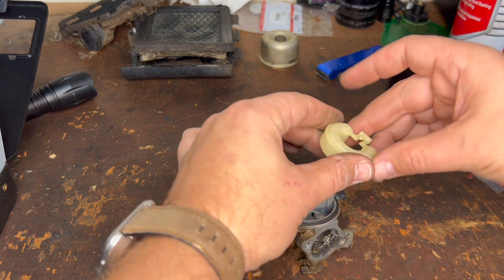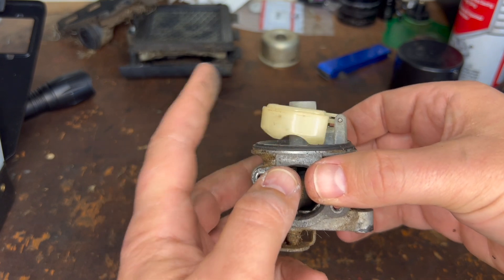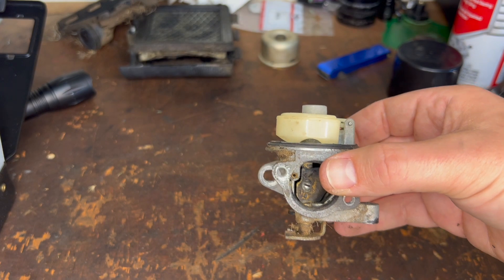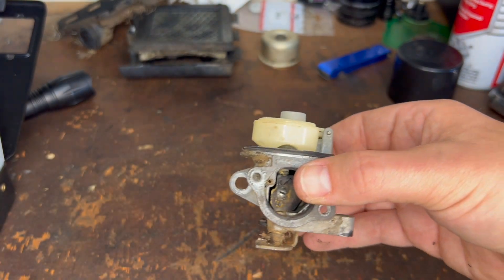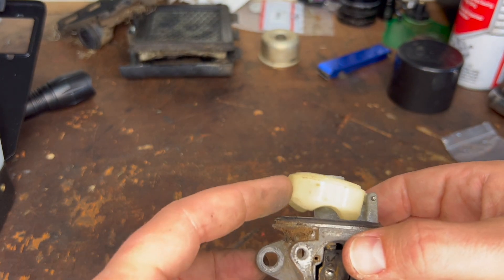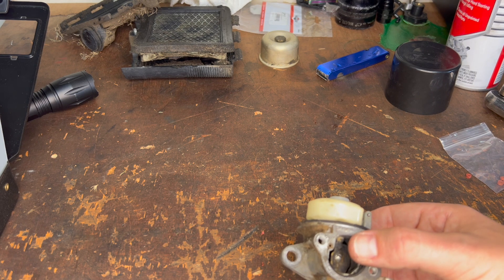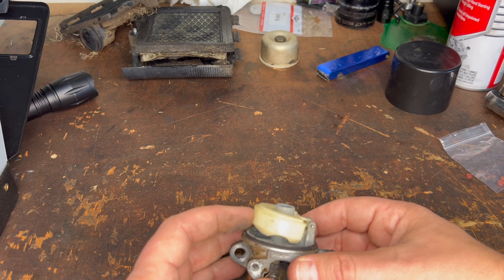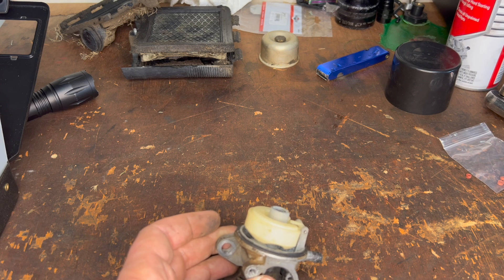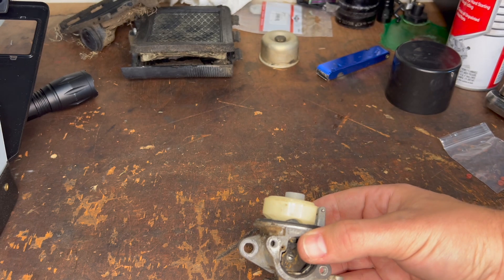Let's put this needle back into the float. Let's see where she sits now. It's definitely better — a little bit more natural. If you push it down, you can see it kind of sits in there. That needle will expand that hole just a little bit over time and it'll probably sit just fine. When the float isn't sitting right, that's an indicator that the seat has swollen. What that means is the hole is too small to allow the proper amount of gas into the carburetor. With the float going up, it allows less fuel to fill the bowl, which means you're going to be running lean and either destroy the engine or run out of gas, or both. But that is the fix, and hopefully that helps people out there with their carburetor cleaning.